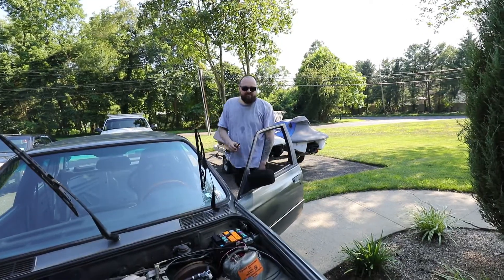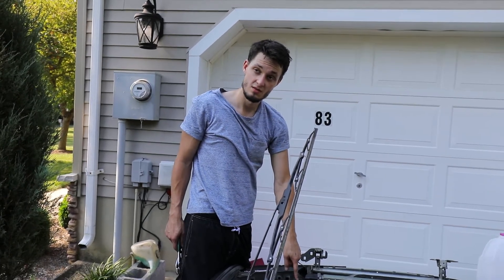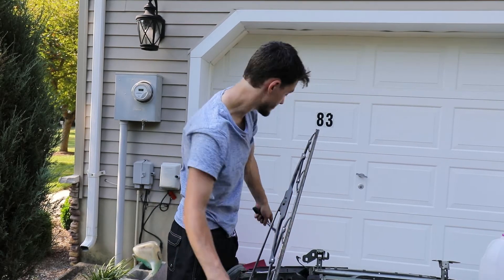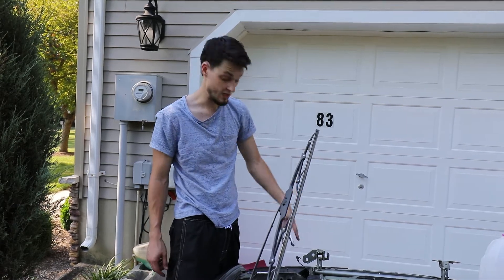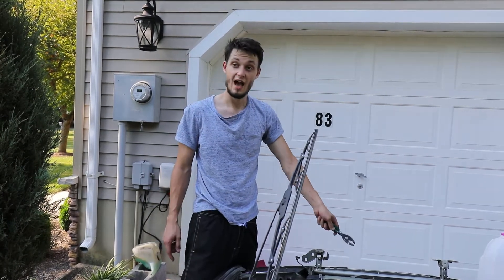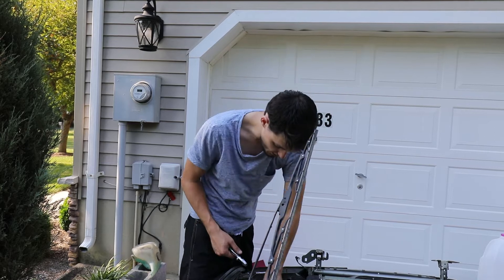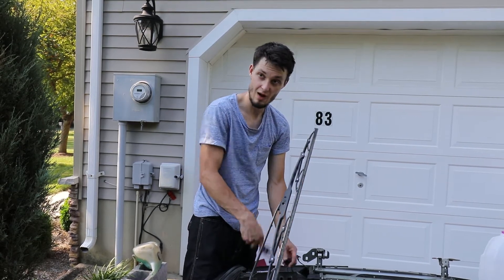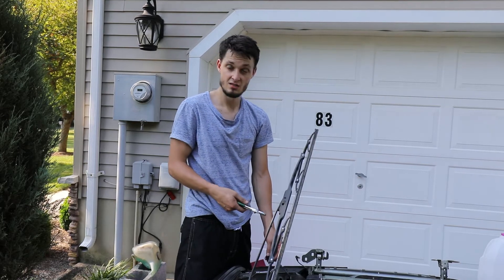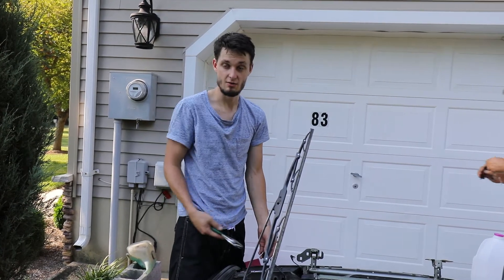So spark notes version for Chris: this will switch on two different speeds. When it's low temperature or high temperature, it'll short two different wires. One goes to the 15 amp fuse and through that resistor to turn the fan on at low speed — if you short those, it's going to blow this fuse because the resistor's not on anymore. If you short the other two, it goes through the 30 amp fuse and turns that fan on at high speed whenever you have the key in the on position. So we're just going to keep it plugged in so it doesn't leak coolant, short those two wires and wrap it in electrical tape, so that anytime you turn the key on, it'll send power to that fan and that fan will go on at high speed. The thermostat will close if it cools off enough and keep it at operating temperature, but if it gets too hot, that fan is now running.